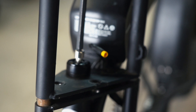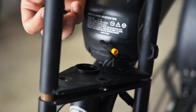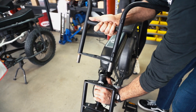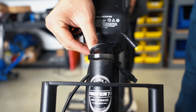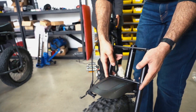Use the 8mm Allen wrench to loosen and remove the steer tube bolt and the installed steer tube spacers. Keep these spacers for installation of the suspension fork. Pull apart the front handlebar while maintaining force on the front wheel to avoid spacers from spilling out. Slowly remove the inner spacers and washers and set aside for reinstallation. Slowly pull the fork down and away from the down stem and set aside.